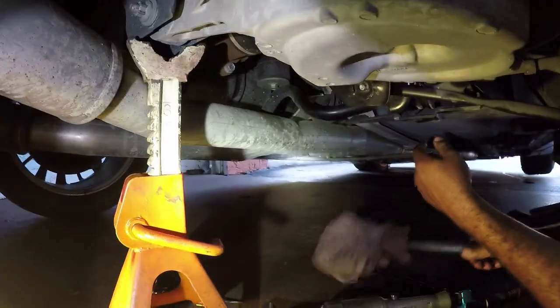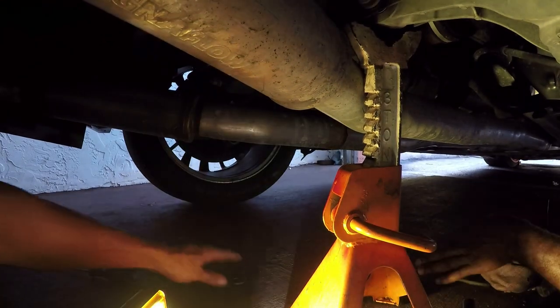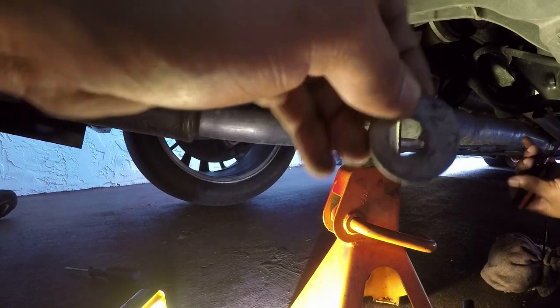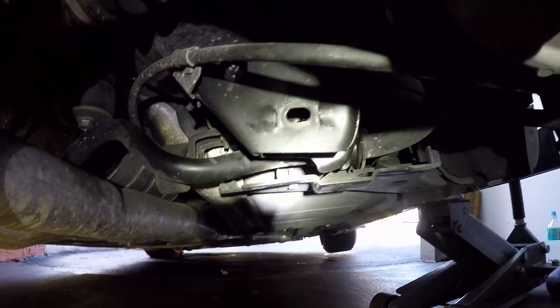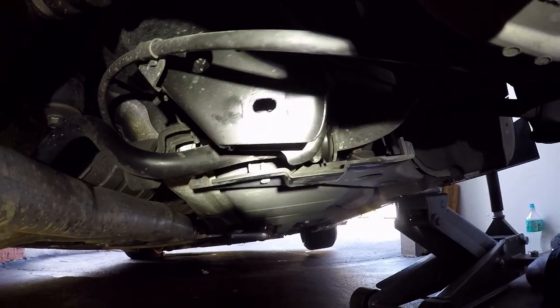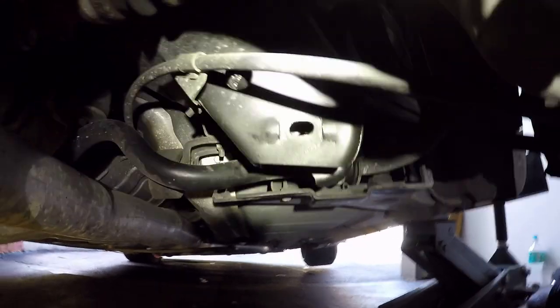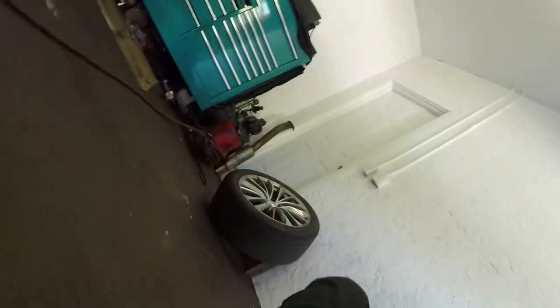When you go to remove that bolt right up there, you need to remove the little keyway that they use to set the camber from the factory — you need to remove that, and then you can tap the bolt. FYI, you do not need to remove the sway bar — once you get one side of the bolt out of the groove, it moves enough to pass over the top of it. As long as you rotate the bolt it'll slide right over, and I'm guessing that's why they give you the new bolt so you don't have to fight with the adjustments.